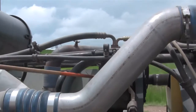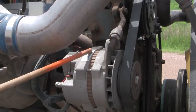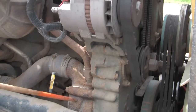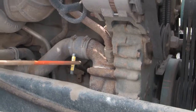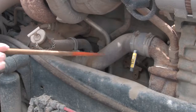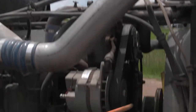This is the air conditioner and the alternator — both belt driven, mounted securely, and the belt's not cracked or frayed. This is the water pump; it is mounted securely, gear driven, and not leaking. Here's where I check and fill the oil — I just make sure that there's nothing leaking. And then I check all the clamps and hoses to make sure that everything is secure and not leaking.